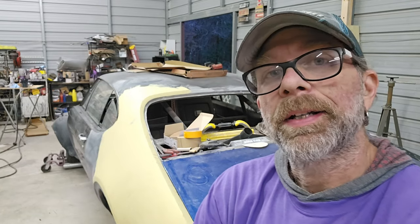Well, welcome to Florida. The last couple days it's been about 80 in the afternoons after work, so I covered the whole quarter with filler. So what I'm gonna do is I'm gonna probably be sanding about 98% of that off now. So I'm just gonna get after it with my long file and some 80 grit and then just cut this down. So here we go.